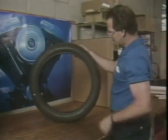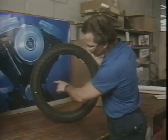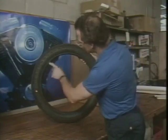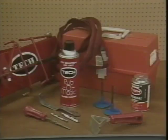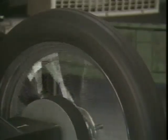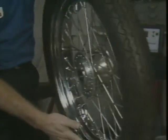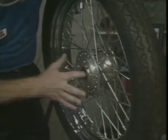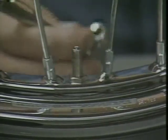After I pull the right tire, I'll look at the markings on the sidewall, point the arrow in the right direction, make sure that the dot is at the valve stem, and caution him against exceeding the load limits or the speed rating. Then I'll begin to mount the tire following all safety procedures. If I run into any problems, I've got all the Kent Moore special tools for tire servicing. I'll do a spin balance, and then before I reinstall the wheel, I should inspect the bearings, seals, and brake pads for possible service needs. And I'll make sure that he knows why it's so important to maintain the tire pressure on his bike.